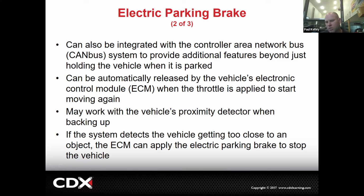I guess bad is not a good word, but well, it kind of is. For the shade tree mechanic, that's bad because now the shade tree mechanic wants to jump in and compress those rear calipers. But they don't even know that if they forget the wheel lock or something, next thing you know, you open the driver's door and it applies the parking brake and blows the caliper clean out because they already got the caliper off the rotor. Makes sense.